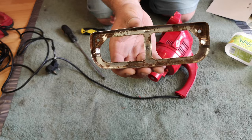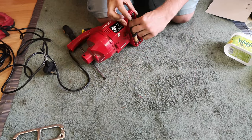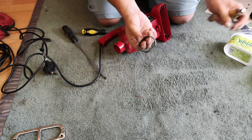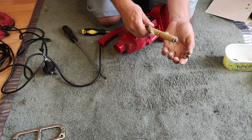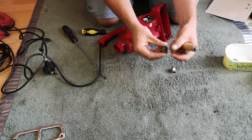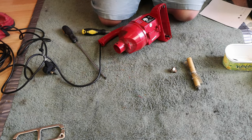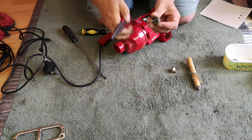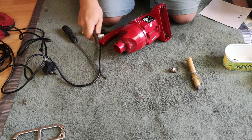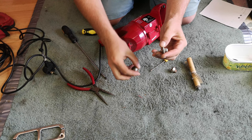We can reveal our base plate. I'm not going to do too much with that rust - I'll just wash the whole thing. The brush roll will come out very easily now. We don't need to remove the belt - that belt is perfectly serviceable. With the brush roll out, we can take the end caps off - they will just pull off, and if you're lucky the inner bit will come off with them. You might need some pliers to help it out.